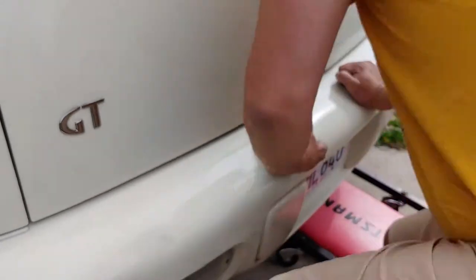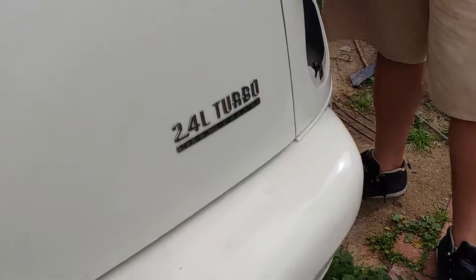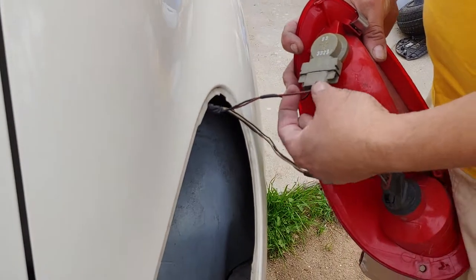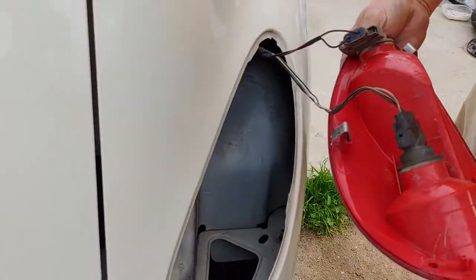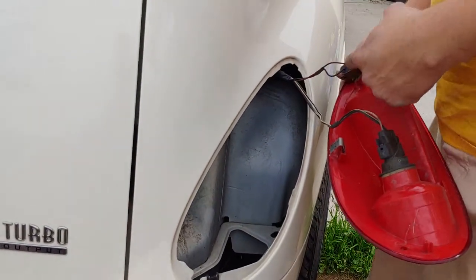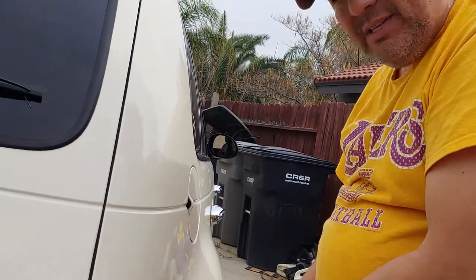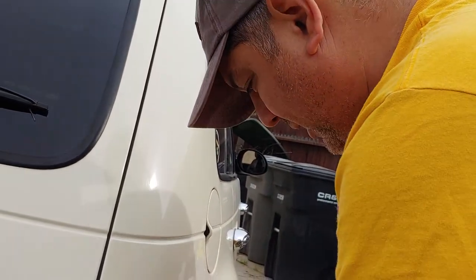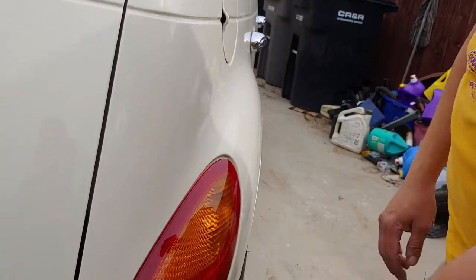So what I'm going to do here in this light — I've already removed it. I don't need to worry about this side now. I only have to worry about my blinker for the right turn. Here's my black for ground, and that's my wire for my blinker. Before I splice, I'm going to run my right light — I'm going to take my tester and poke it in there, make sure this color is in fact the one that's going to blink. I don't want to get those two reversed. I just want to make absolutely certain. Then I'm going to take this back, make sure my wires are tucked in, put my light at the bottom, and that's it — put my bolt back in and you're all set.